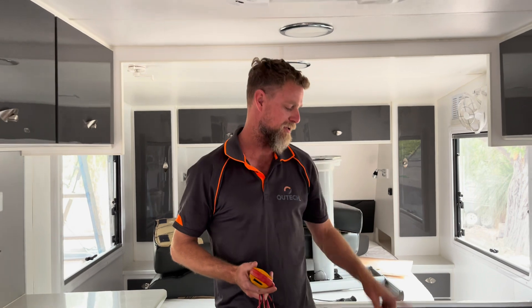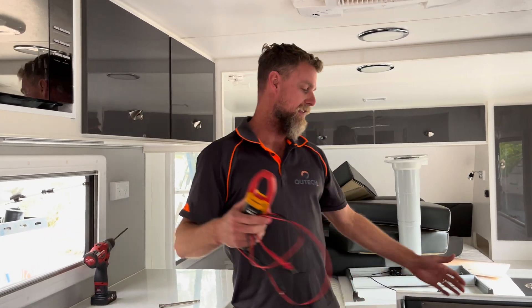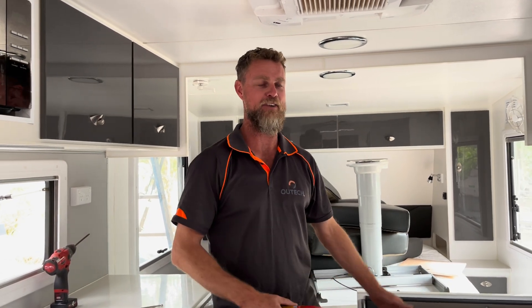This could also be the reason why the coffee machine was causing the inverter to overload - because there's already a substantial load on the system, plus the coffee machine which is about 2,000 watts. Adding the battery charger load and the coffee machine together overloads the inverter.